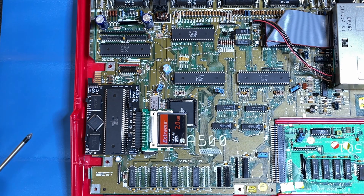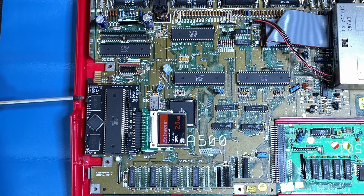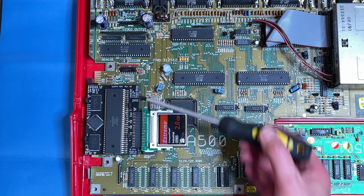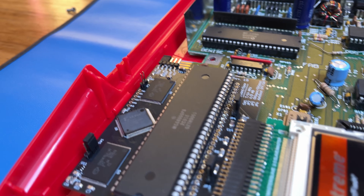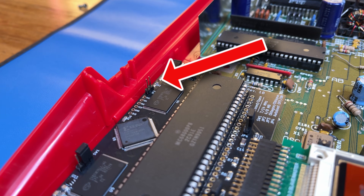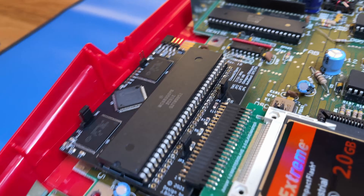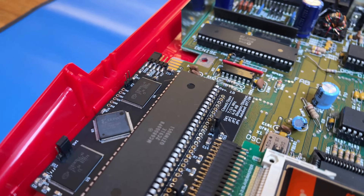So this was showing 4 meg of RAM, it needs to show 8, and there's a jumper just in here - JP2. I just need to remove that cover and that should give us the 8 meg, because over here on the actual card itself it does say JP2 4/8 meg. We know we're getting 4 meg at the moment, just need to take that off and it should give us the 8 meg the card can deliver. So here's some shaky handheld camera footage just to show that the cap on the JP2 jumper has been removed. With it on we've got 4 meg of RAM; with it off we've now got 8 meg of RAM.